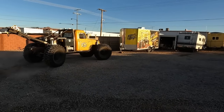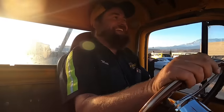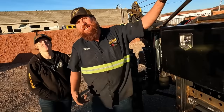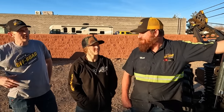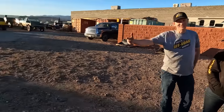The wrecker is alive — finally rolling under its own power, not electric. Initial first drive impressions: we need levers to shift the gears because the pliers are not working well. We do need to hook up the hoses for the master cylinder booster. We got it in gear but don't know if that's low or low-low. It's plenty frisky though — look at this, it tore up the gravel. Because of the brake and shifting situation, I'm not getting froggy with it — this is quarter-throttle stuff. It has not had the pedal to the ground.